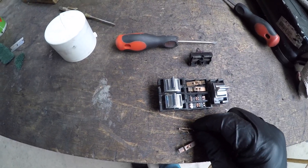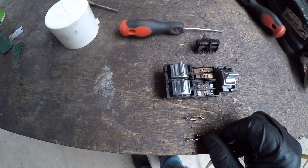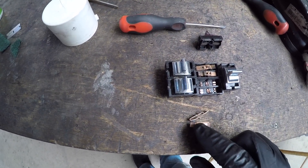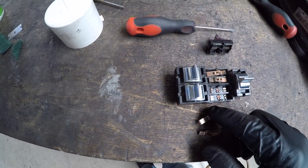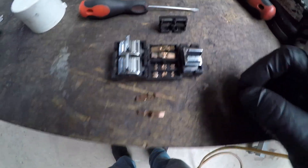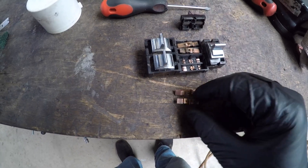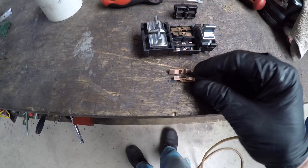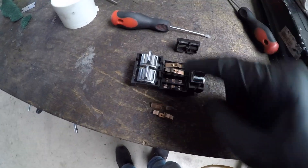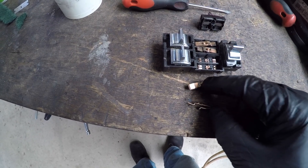Just done the first clean-up, and I've popped another one open very carefully just to show you the difference. You can see these cleaned up beautifully. I've just used a bit of methylated spirits and compressed air, cleaned it out. Nice and clean. And just to make sure my orientations are right — because obviously these are the two rear windows — I'll make sure that one marries up to that one.